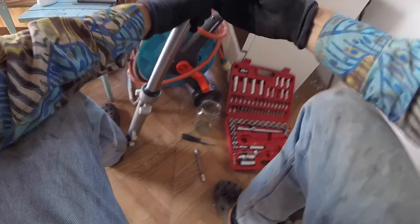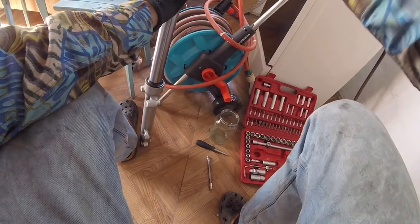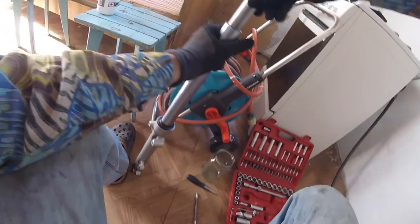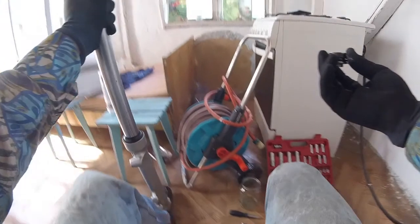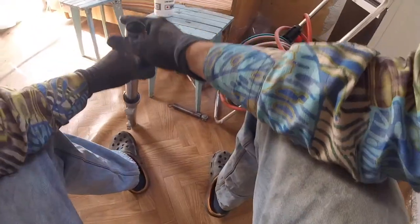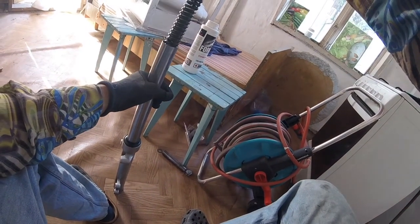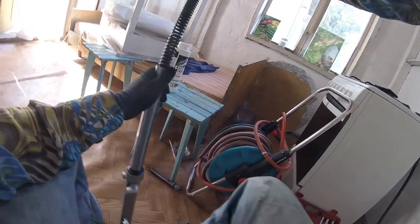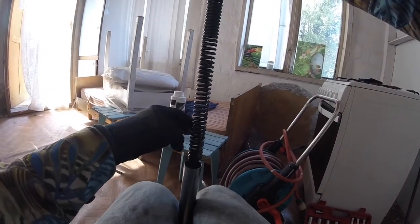Remove the top nut — don't lose anything. I've already removed it before, so this is how it was all assembled. Consider removing this one first, and you need to mark the sequence so you don't forget where everything goes. First goes the nut, second goes that piece, third there is the spacer. Don't confuse all of that — it's good that the camera is recording. And then there is the actual spring, which is wider at the bottom and narrower at the top.